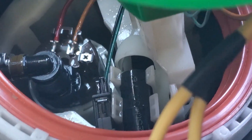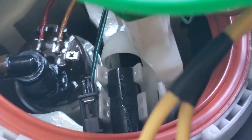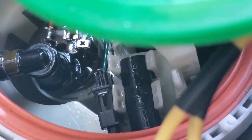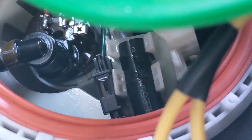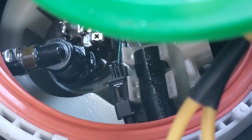That's actually the crossover tube — it doesn't seal or anything, it just goes right in there and dumps into the basket, so you've got to pull that off. I moved the clip that goes to that other pump slightly over to get access to it. You want to make sure you don't lose this in the fuel tank, so I'm just going to disconnect it and hopefully tie a string to it or something to keep from having to dig it out later.